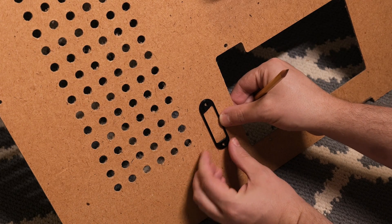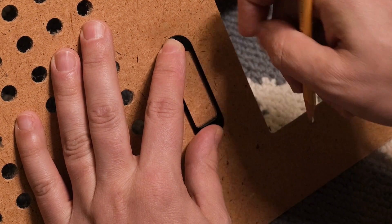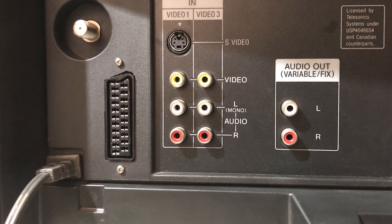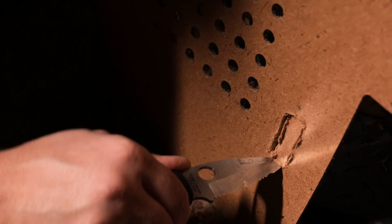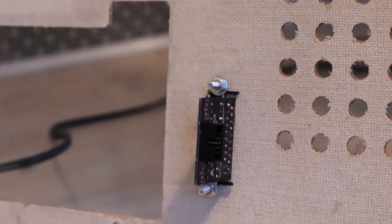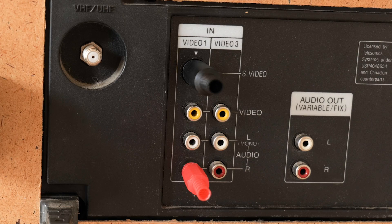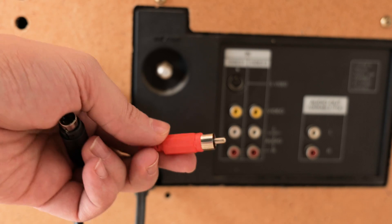Now to put the SCART connector into place. Using a SCART template I got from console5.com, I used a pencil to trace the outline of the connector to give myself a guide on where to cut, and marked where the screws will go. With plastic TV backs you may have to use a Dremel tool to make your SCART connector hole, but this particle board was so soft I basically just slid my pocket knife through the back and carved a hole following my pencil guide. My connector slides right in there. I drilled some holes for my number eight, three-quarters-of-an-inch long screws, and the connector is in place, with washers and nuts locking it from the other side. Then I screwed the back panel back on. Here's my fully functioning SCART input. In order to make it work properly though, you need to plug a dummy S-video connector for sync and an RCA plug into the right audio channel to enable stereo sound.